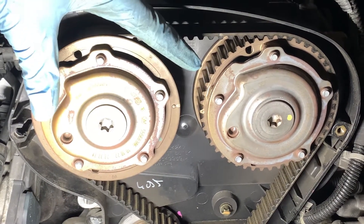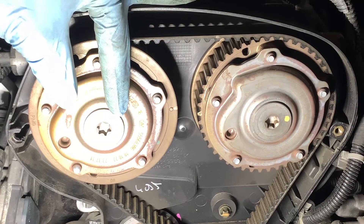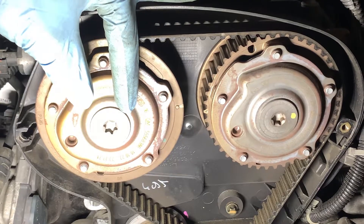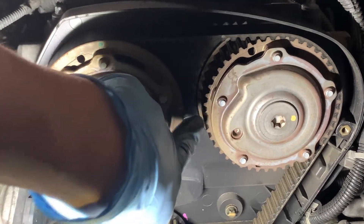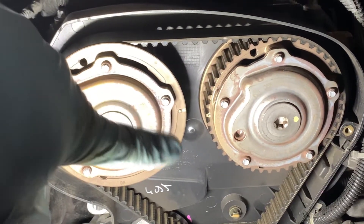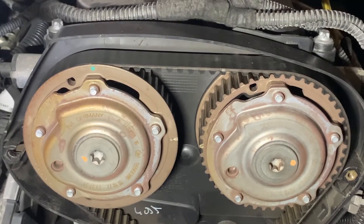It's going to do it automatically, so you don't have to worry about it. As long as the pink mark is lined up on the crank sprocket with the arrow on the block, you're good. Don't be concerned about these two not lining up perfectly — that's how it's supposed to be. And to be sure that we won't misalign it when we put the new belt on...